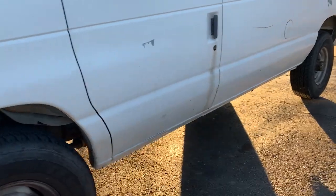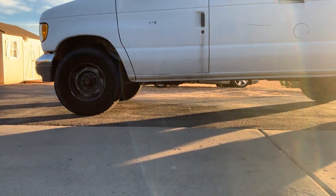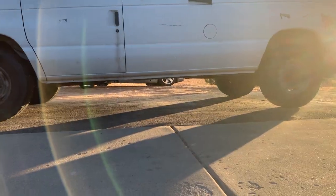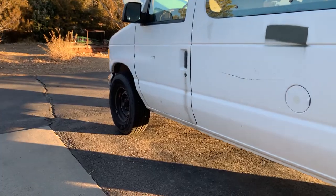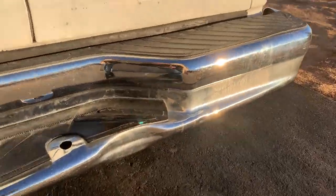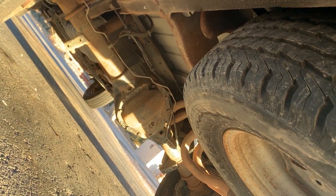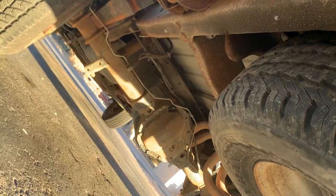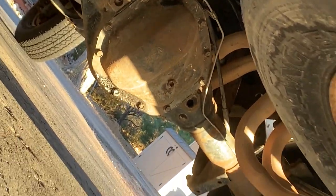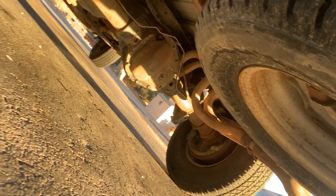This van is rear-wheel drive but it's got quite a bit of ground clearance stock — you can easily crawl under there, which is nice. A four-wheel drive conversion would be cool but it's just so expensive. In the back I'm not sure what differential it has — probably some Dana. It's an open diff, not LSD unfortunately. It's seeping a little bit around the pumpkin cover, so one of the early things I'll do is pull that cover off, drain everything, and reseal it.